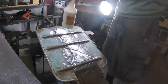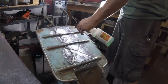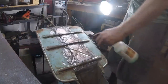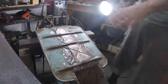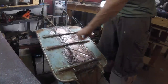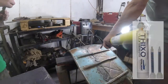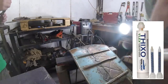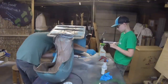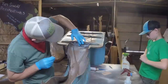I used a rust patina treatment to just make the repaired area match everything else and let that sit. Then I used TotalBoat Thixo — a two-part epoxy product designed for basically plugging up holes on boats. I went around and put a thin coat over everything to fill in all the gaps and cracks and keep the whole underside watertight. I had used it on my box truck where there were some leaks and it worked great there.